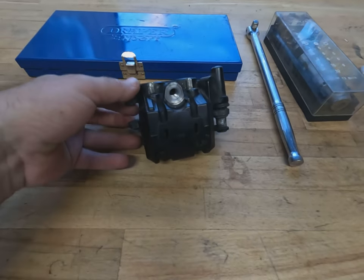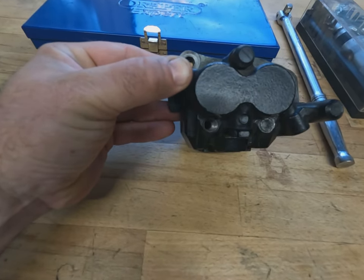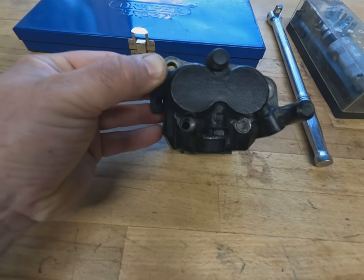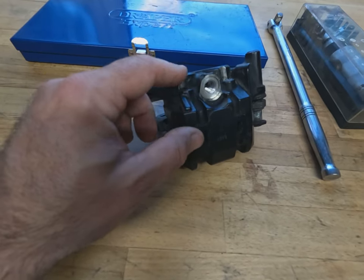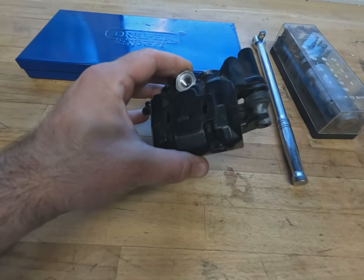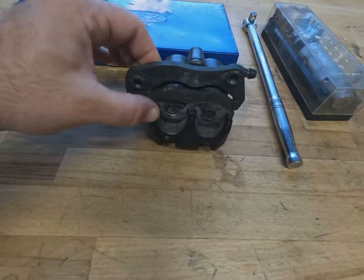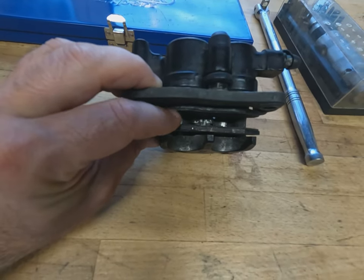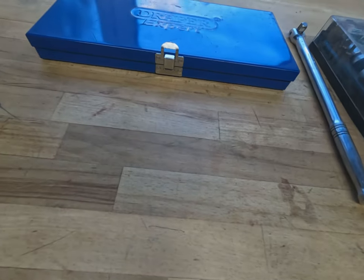As we can see, we've got the rear brake caliper off the bike and we've got an issue with one of the pad retaining pins — quite a standard issue. Somebody's absolutely mullered the thing, so one of the pins is out; this one here is stuck in. We've taken the caliper off the bike for better access. We can't take the pads or the retaining plate off yet as the pin is stuck in there holding everything together.